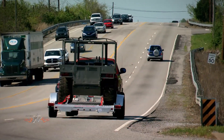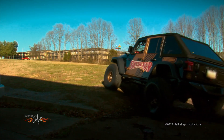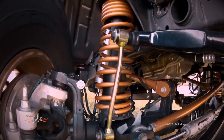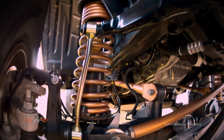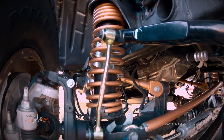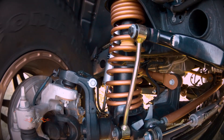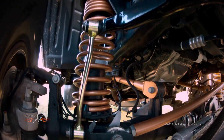When you throw cargo in the bed or hook up a trailer, the spring transitions into the heavier rate to handle it. The dual rate design is also great for long travel off-road suspensions. In that application, the lighter spring acts as a flex coil — mostly compressed at ride height — while the heavier spring provides control and stability during increased suspension movement. When things get really extreme and the axle needs to articulate, the upper spring expands and separates to give you extreme flex in off-road situations.